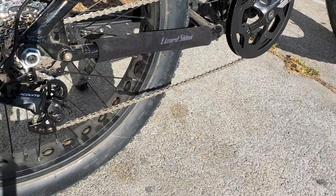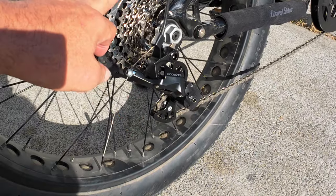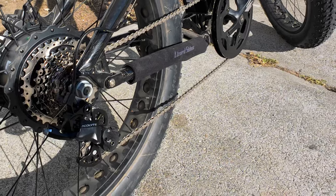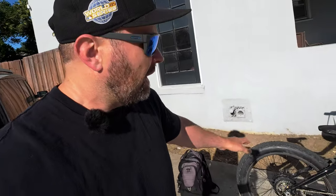The clutch keeps tension on the chain so when you're riding over bumps and obstacles the chain won't slap around as much. The derailleur was only 33 bucks, the freewheel was about 40 bucks, and the shifter was about 11 dollars — a very affordable setup. Today we're going to test it and see if it does in fact eliminate or significantly decrease chain slap. I'm not trying to single out the Esos Five Star because this Shimano Tourney derailleur comes on the lion's share of all e-bikes available.